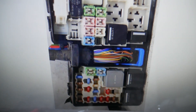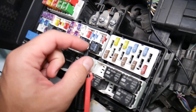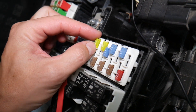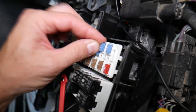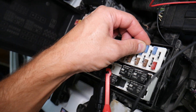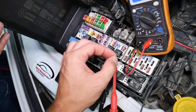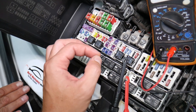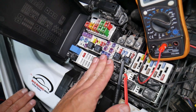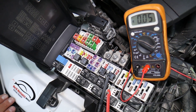Let's explain quickly why it's always a good idea to test fuses and relays. Fuses — not often can you see visually if they're burned or good. Sometimes they may seem perfectly fine, you think it's a good fuse, you put it back in, and you end up spending money and time on parts and problems that do not exist. All you have to do is test your fuse, find out it's bad, replace it, and fix your problem. We will have a video on how to test a fuse and different kinds of fuses, and how to test relays — we're going to put the link in the description below.